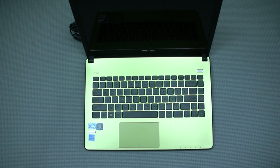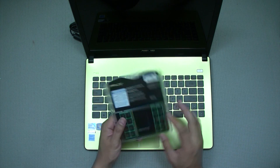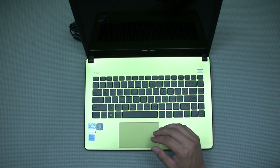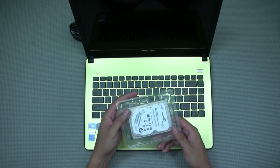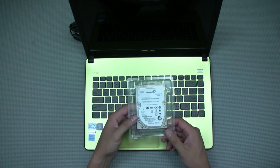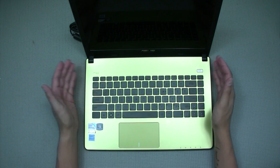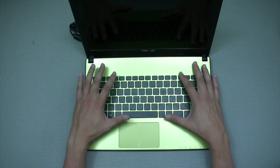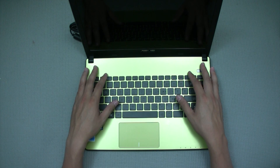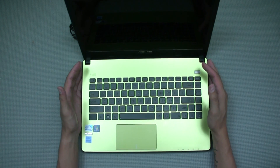Once I take it apart, I should be able to upgrade the RAM and hard drive. I'll actually be doing that — upgrading from 4 gigs to 8 gigs of RAM, which I picked up online for about $40. I'll also be upgrading to a 750 GB Momentus XT hybrid drive I got for around $120 on Amazon. Links to everything will be in the description. For the average or college student user, the stock configuration is perfectly fine — I'm upgrading because I need more speed, power, and storage for my personal use.